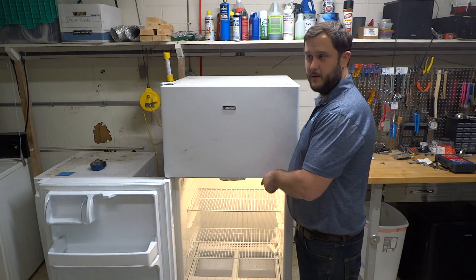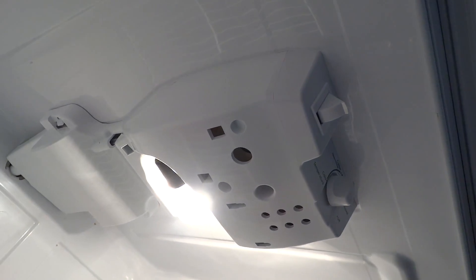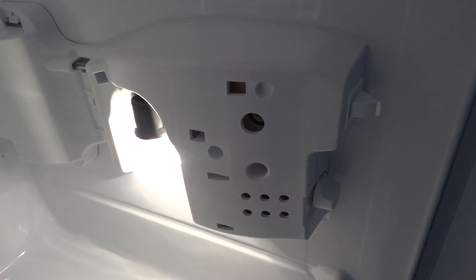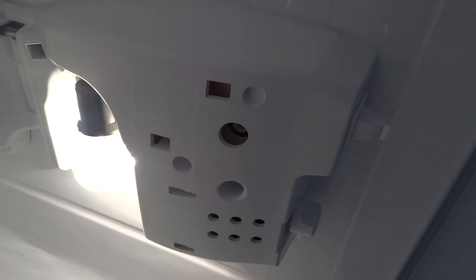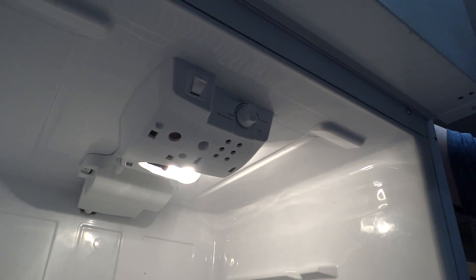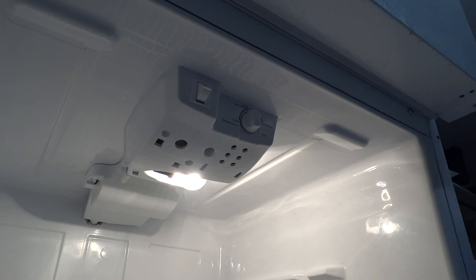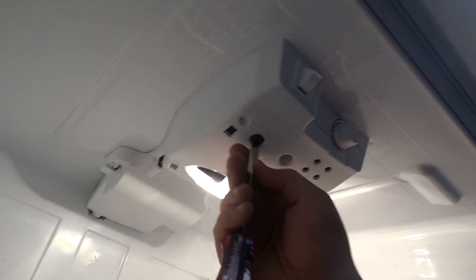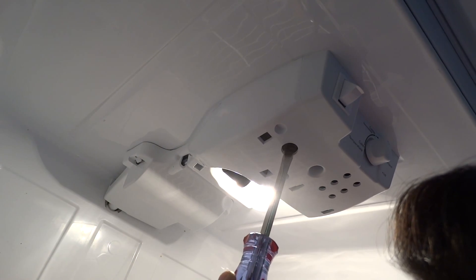In this refrigerator, the defrost timer is located in the same section. If you look in here, right up there, there's a little plastic or rubber piece — it's got some catches. That's called your defrost timer. What that does is cycle the refrigerator from the cooling side to the defrost side. Sometimes that motor in there gets fried or the little links in there aren't able to catch and can't draw a current. We're going to try to test this one. The way you do that is just get in there where the grooves are, line up a flathead screwdriver, and spin it. It takes a second.